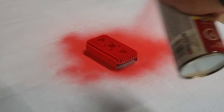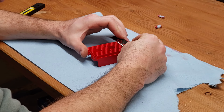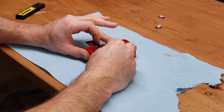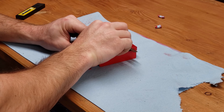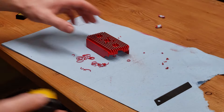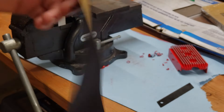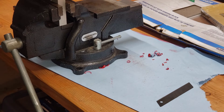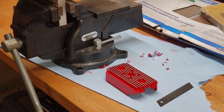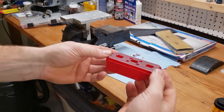After 36 to 48 hours, I removed the wax on top of the head using a new box cutter blade — it was honestly a pretty satisfying feeling. Once done, there was still a little bit of paint left, so I used a thin strip of sandpaper to remove that last coat. I know it does remove some of the anodizing this way, but I'm willing to accept that. And just like that, the head came out absolutely flawless — even more beautiful than I was expecting.